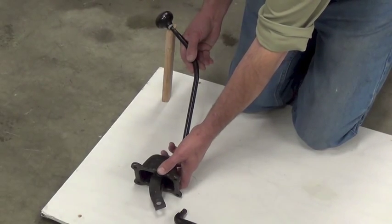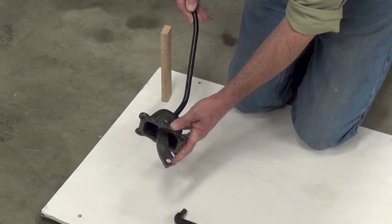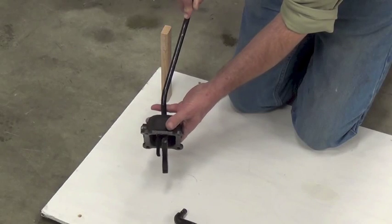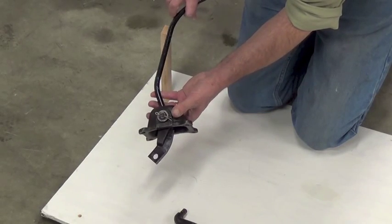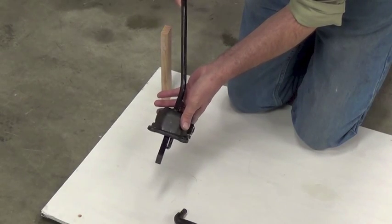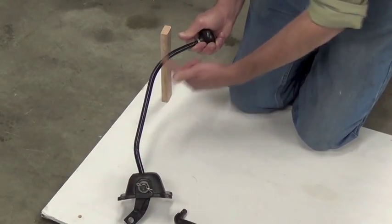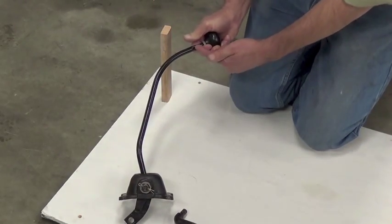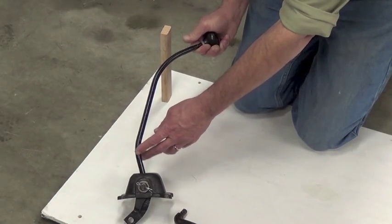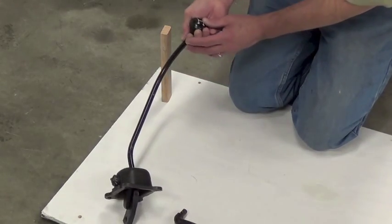This is the cab shifter itself for the 4-speed. You'll notice that it has just one shift lever underneath, not twin like the T90 3-speed cab shifter. The base is very similar to the 3-speed — it bolts up the pattern on the cab floor the same way. You'll notice that the stick, though, has a different bend to it, and most of the 4-speeds I've seen have this arc to them, as opposed to the 3-speed, which has a bend at the bottom and the stick itself is relatively straight to the shift ball on top.